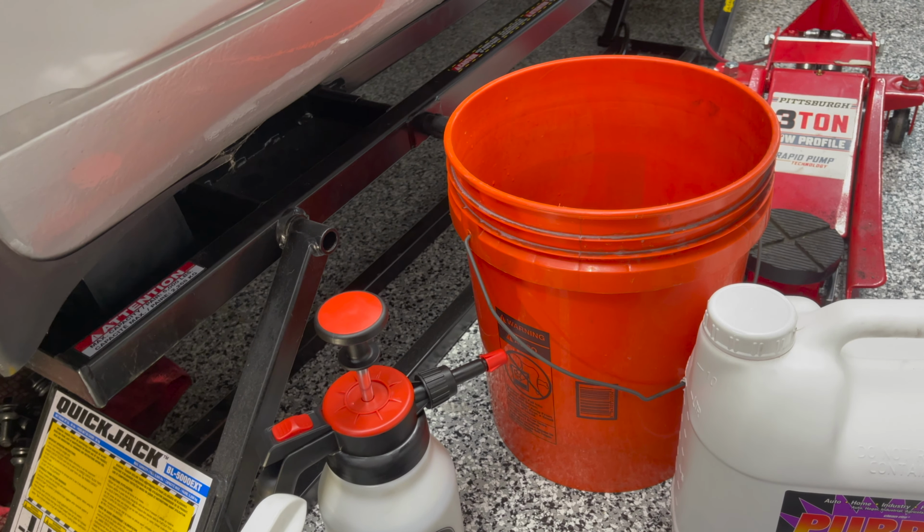So I'm gonna put it all together, but I'm gonna have to use the spring compressors to hold it all into place. So the narrow part of the spring goes down and sits on the spring plate on the bottom. Got it? All right, I forgot one thing, and that is your bump stop. There's a notch on it that goes upward, and that's where the thin washer sits on your bump stop. So back to where I was.